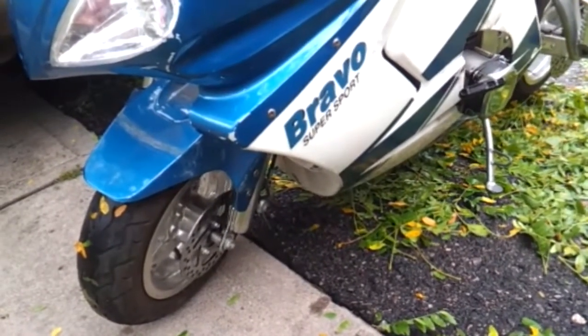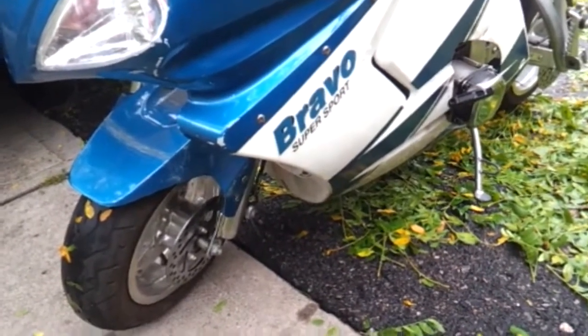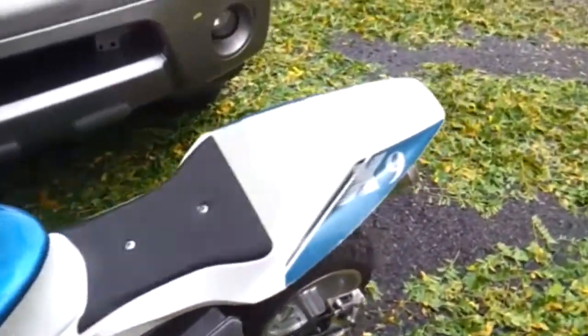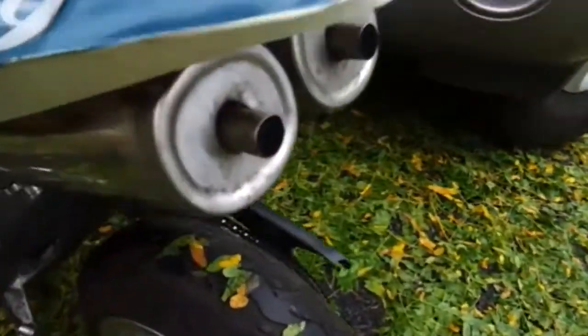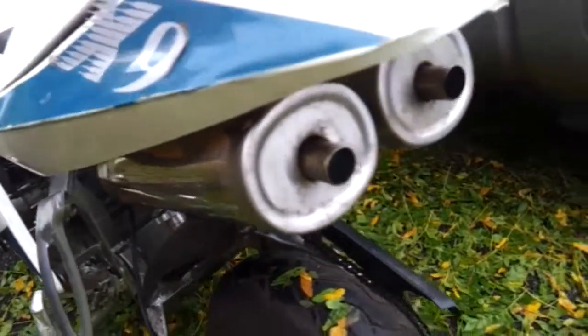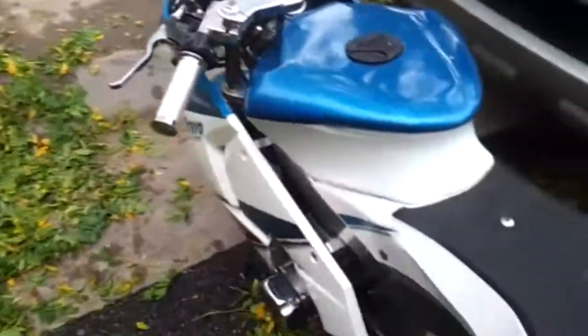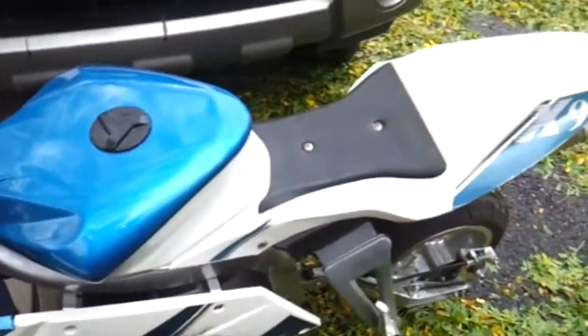The problem with this bike — I don't like how it's running right now, but there's really nothing I can do. I think it's due to the way that it was broken in. It's running really rich on oil, so the smoke coming out of it — you could possibly even see a little bit of smoke still coming out, little clouds of smoke. That's still coming out not just from it being run incorrectly, but broken in incorrectly with too much oil. That's why there's too much smoke.